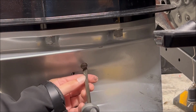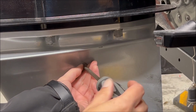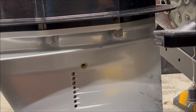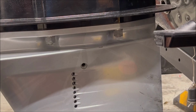And here's that vent drain. Once you undo this, you should see your lower unit start to drain a little bit more freely. And this too, there it is, it's stuck there. It also has one of those little yellow gaskets. And same thing applies there. Either reuse it, it's in good shape, or replace it, it's cheap insurance.